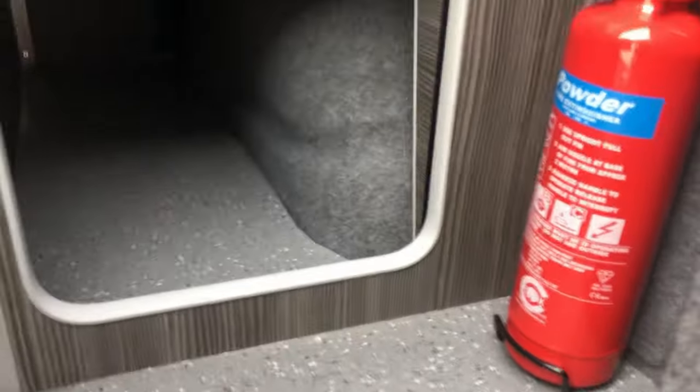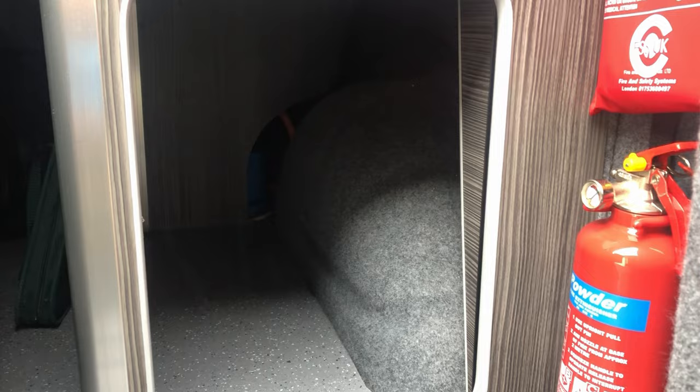And then we will look at coming up through into the cupboard. We might be able to come up through and behind the cupboard here. So we'll just give you a bit of an insight to the cupboard there. Just grab the light so we can take a look. So then, as you can see, we've got some existing wire in there. So what we'll probably do is run along the cupboard here and then into that trunking there. And then what we'll probably look at doing is mounting the fuse board the other side on this panel here.